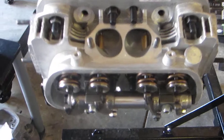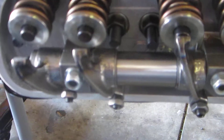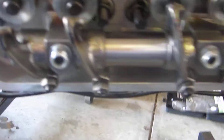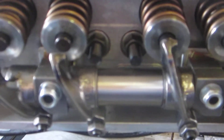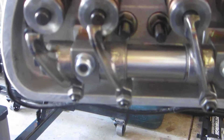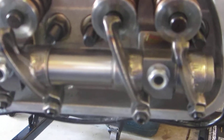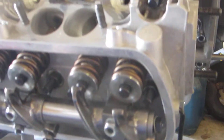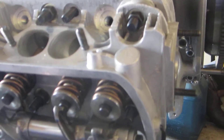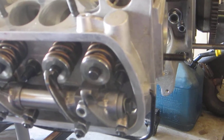On the heads are some 650 double springs with some 1.4 solid shaft rockers that CB sells, and this is going to require a great deal of work with the valve train geometry once I get to that point — that's far down the road. Right now we're just putting stuff together to see if it fits, but there will be some video content around getting the correct rocker geometry, so more to come on that.